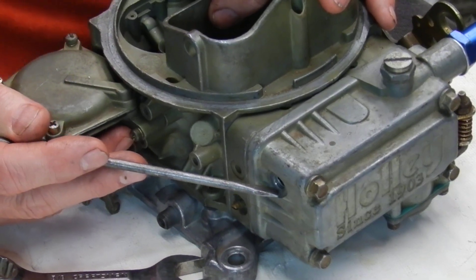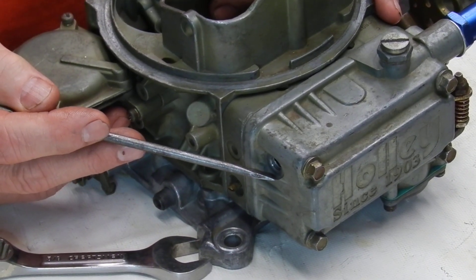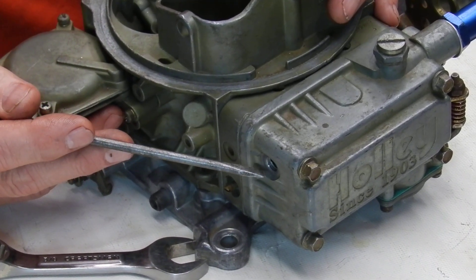So if you're just a little rich and you don't want to make a jet change because it's not much off, just try lowering your float level about an eighth of an inch. You can maybe even go down to three-sixteenths of an inch without causing any problem.